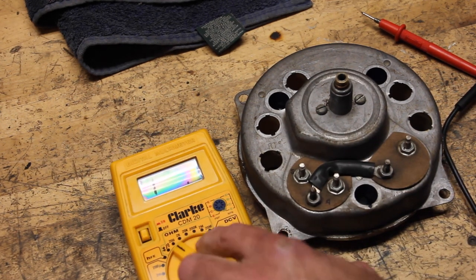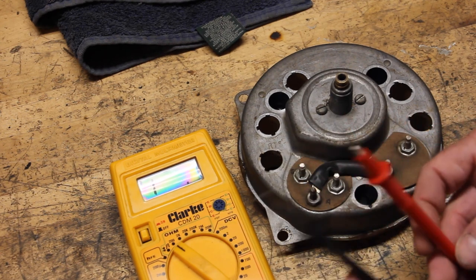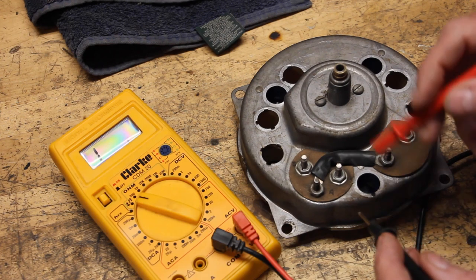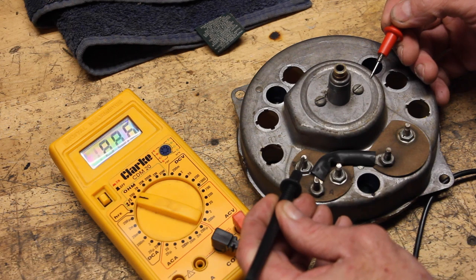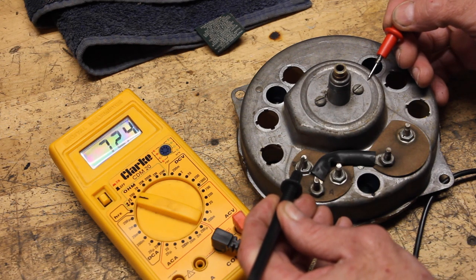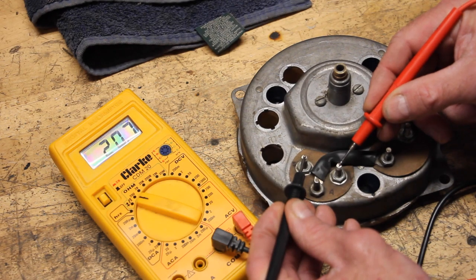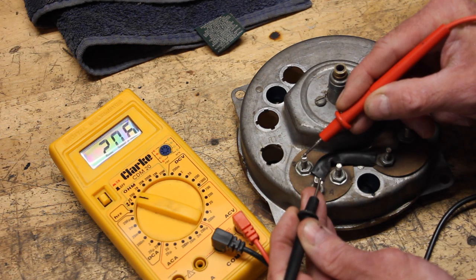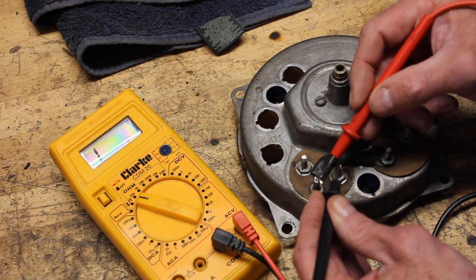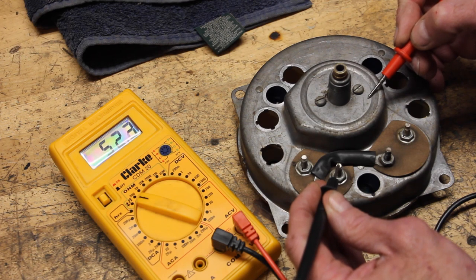Get yourself a voltmeter, put it to the ohms reading — the lowest setting, this one has 200. It really doesn't matter whether you use the black or red lead. We'll start with S to ground: one lead on the S, the other grounding to anywhere in the speedometer housing. This should be between 68 and 72 ohms. This voltmeter is about 1 ohm off, so it registers perfectly. S to I post should be between 19 and 21 ohms — right on. From S to A, this should be 21 ohms — right on. I to A should be zero — no resistance whatsoever. I to ground should be between 49 and 51 ohms — right on. And A to ground should also be between 49 and 51 ohms. Perfect.